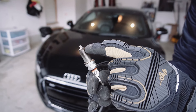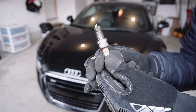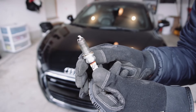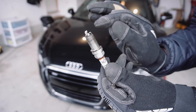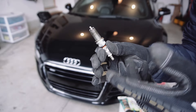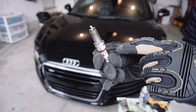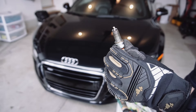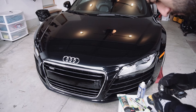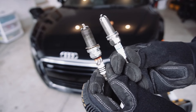Let's examine it — there's quite a bit of wear here. I don't think this was replaced for about 120,000 to 130,000 kilometers. This is the Iridium plug — the same Denso OEM plug we're going to be replacing it with — but you can see there's significant wear in the plug, which has probably caused some performance issues and misfiring. You can tell by the condition of just this one that they were due for replacement. Versus our new plug — you can see the big difference between new and old right there.